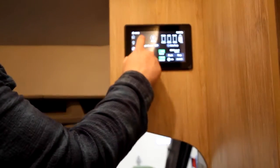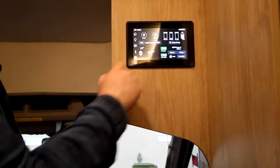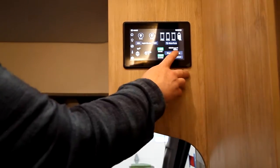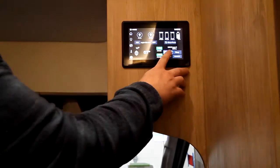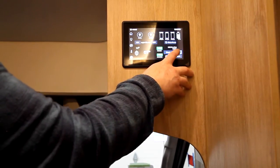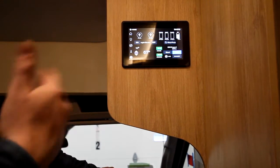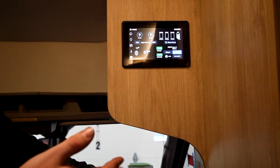We have our water pump here — anything that's on is going to be indicated by a blue light. This here is just your thermostat — you can turn it up or down. We have our voltages and our generator start and stop here. Just like outside, this is a push button — you can start the generator from here. I'm going to turn that back off because we're plugged in. You don't want to have your generator running the whole time while you're plugged in — it's going to make your transfer switch go crazy.